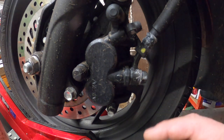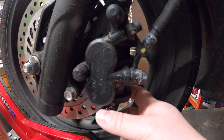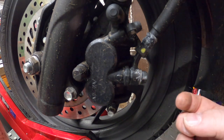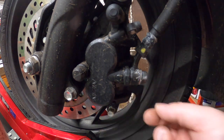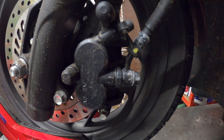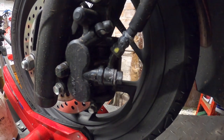I'm going to take these two bolts out — these are two 12s. Then this should just be the slider pin that holds the pads in. I'm going to crack this while they're still physically mounted. Quite often I forget to do things like that. I'll crack that off so we can get the pads out easy. On this particular one we do need to take the caliper off.